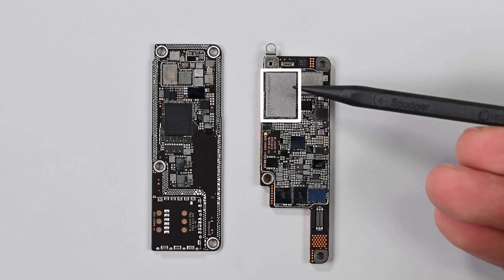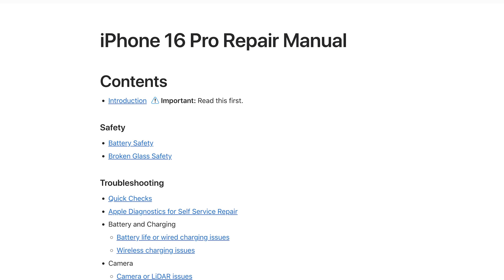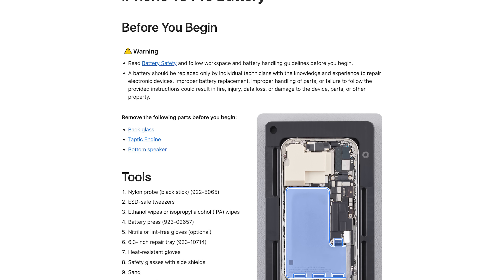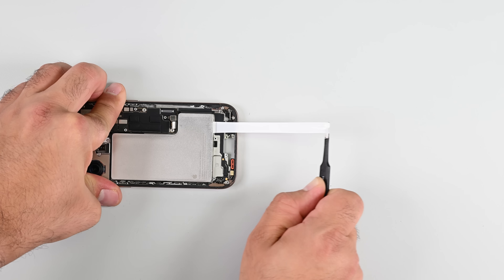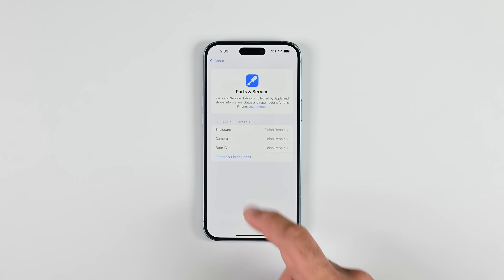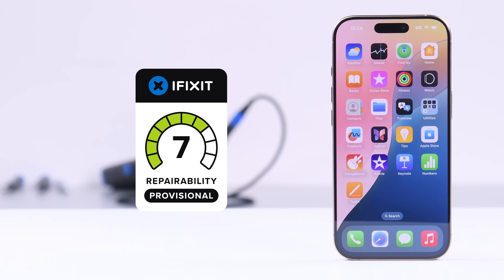On the reverse side we have the Kioxia 128GB NAND flash storage, which is the minimum capacity available on the 16 Pros. The repairability story for the iPhone Pro and Pro Max is much the same as the regular iPhone 16: Apple made repair guides available on day one, there's a dual-entry design allowing repairs without removing the screen, and battery pull tabs make battery removal easier. iOS 18 allows the majority of parts to be freely replaced with OEM parts, and we're still testing third-party component support. With everything considered, the iPhone 16 Pro and Pro Max score a provisional 7 out of 10 on our repairability scale.